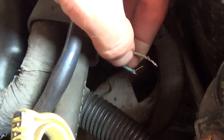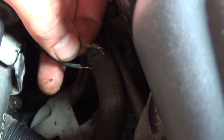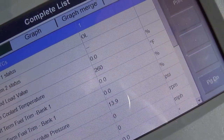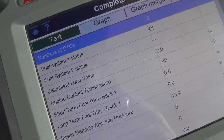I tried to figure out where these wires used to go to, and I pulled off a little piece of insulation. Two wires — this one looks like black with a blue tracer, which is usually a ground on Chryslers, and then a brown and black wire. So quick and dirty, let's ground out this brown and black and see if our data changes on our scan tool. I'm just going to touch it on this metal bracket here and look at our temperature. There you go — 260 degrees Fahrenheit. That's a short circuit reading. Confirmed diagnosis.